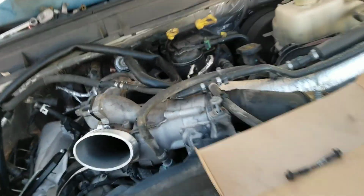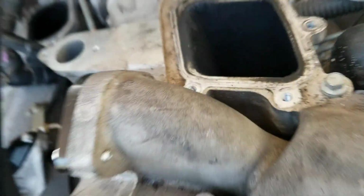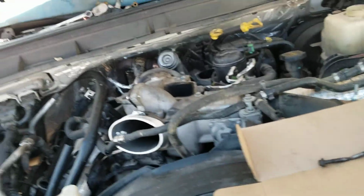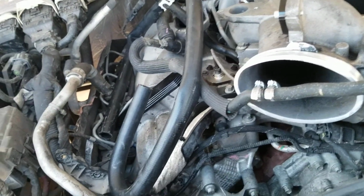So what else? I pulled that, and you can see that plastic intake bolts to everything over here. Then all this stuff up top. Obviously, I haven't routed this yet. This one's actually not even hooked up yet, but anyway, I pulled this pipe off. That one has like a circlip deal. And then an 11 mil regular style clamp there. Pull that out of the way, and then you gotta just kind of finagle it out of there. Not very much fun. I mean, I say that, it's really not that bad. So obviously unplug all your EGR stuff, which I've got zip tied down here out of the way, kind of hidden. Comes with a cap to cap off your vacuum line. Comes with this bracket, I guess, for the back pressure sensor.